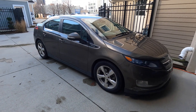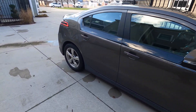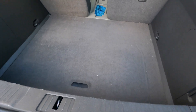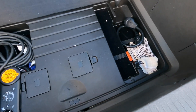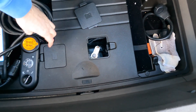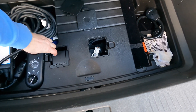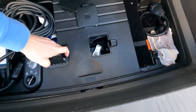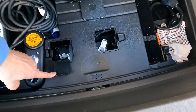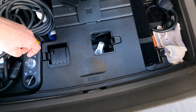There are some vehicles like the Chevy Volt where the battery is not under the hood, so you have to know where to look for it. In this case, it's under the rear hatch. Open that up, take all the stuff out of the back, open up this little floorboard, and underneath here you can see the access ports so you can at least check the voltage using these. There's your positive, which has a separate cover, and there's your negative — so you can at least check the voltage.